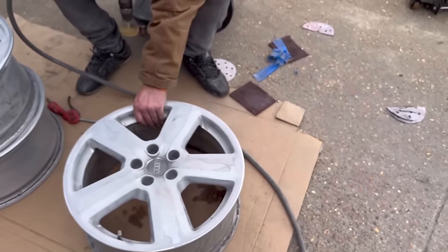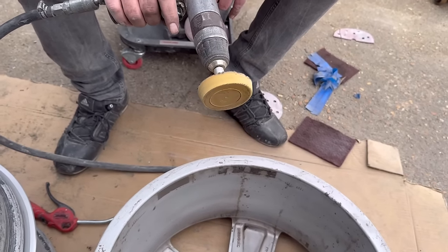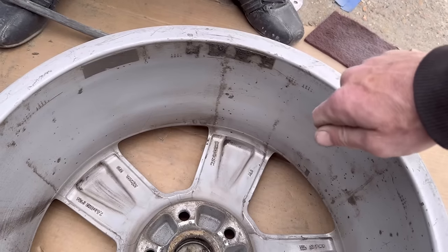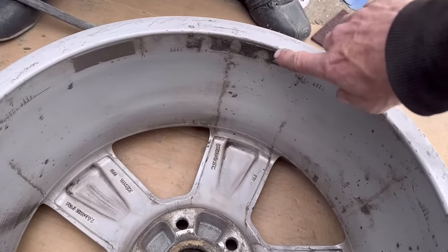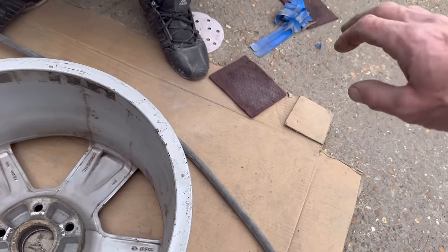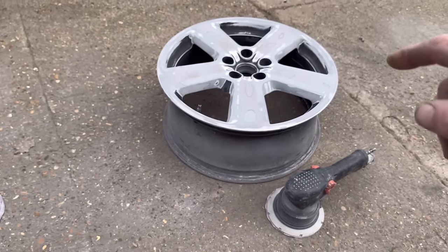The insides are a bit minging — we're going to paint the insides too. There are old sticky weights and Andy's got a toffee wheel on an air drill. You can use a normal drill but he's on the air drill. The toffee wheel gets all the weights off, then he peels the weights off with a flat head screwdriver. That's going to leave some sticky marks and he'll toffee wheel all of them off. Then we've got red scotch — we're painting them in a single stage, which is quite thick, so we can use red scotch. He's on the inside, I'm on the outside.